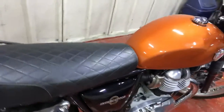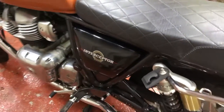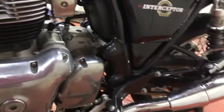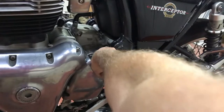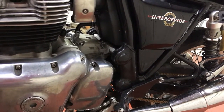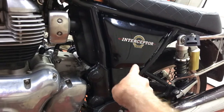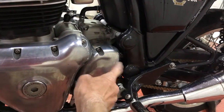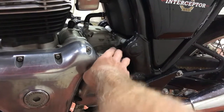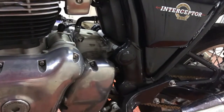In actual fact, I tried doing it last night and gave up and put it back together — I just couldn't get the damn valve. However, I discovered tonight the way to do it, and I'd like to share that with you. The purge valve lives in there on a lug off the battery tray underneath, and the purge valve slots onto this lug. What you do to get at it is remove this left-hand side panel, then remove the sprocket cover — that's the critical bit I missed last night. Removing the sprocket cover gives you the space to get in, and a combination of access through there you can reach the valve.